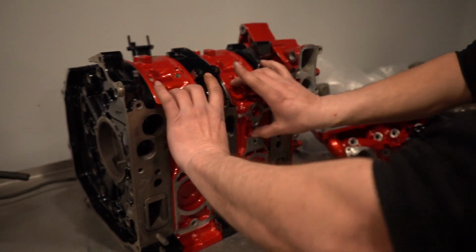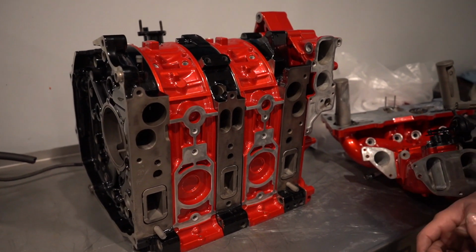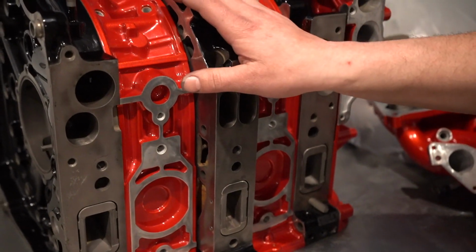After that, we will go and do a set of full peripherals. This is all going to be based off of data that we receive from the hybrid, to see if it did make it better, or if maybe we're hitting a restriction with the intake at that point because we have so much exhaust flow without the full peripheral. So after that, we will run a full peripheral with the hybrid setup and see if that helps. One thing I'd like to do at that point would be to change out the center plate here for a GSL-SE plate.